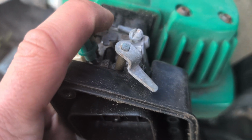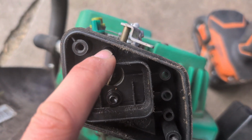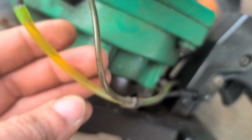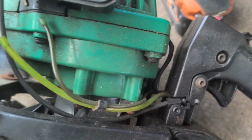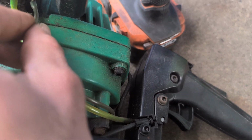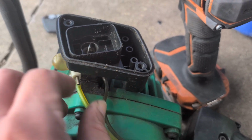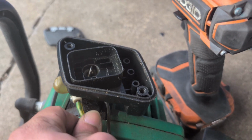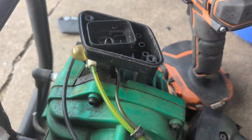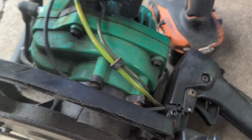We have our throttle cable hooked up, the 2 bolts that we took from here. Now the skinny hose that goes to the rear of the carburetor, which is way down here. You see it down there, and I was just able to twist them back and forth, and that did the trick, so I didn't break them. Sometimes these get toasted by the heat, the sun, they get brittle, get old, and they break, and you might have to replace them.